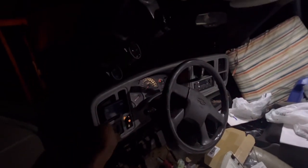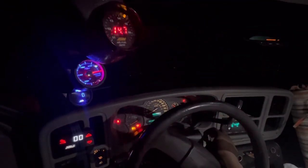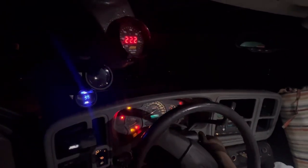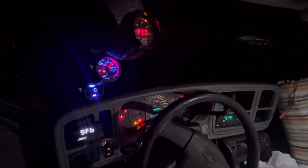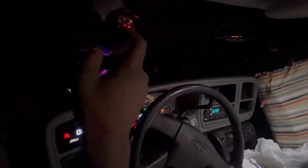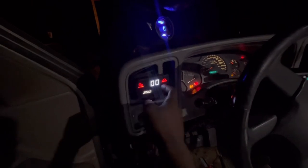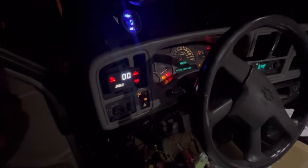We're going to leave that out because I don't know if the headlight switch source is at this panel — I couldn't see any dropout or voltage when I switched the headlights. I'm guessing it's up top; let me know if it's in this bottom or top panel for Silverados and Tahoes. Do y'all see how crisp that comes on? The reason I went with the GlowShift is they look pretty cool. This is our fuel pressure, this is our trans temp which we still got to hook up, this is our air fuel ratio gauge, and this is our boost control gauge.